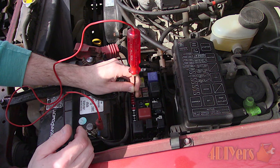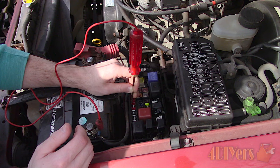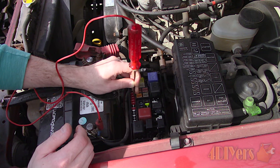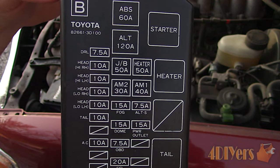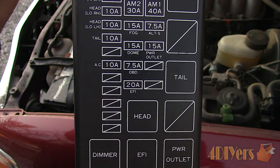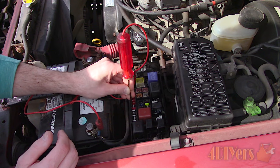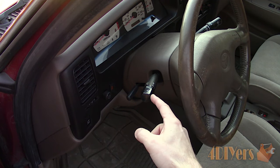On a good fuse, the test light will work on both sides. If the test light only works on one side of that fuse, that means the fuse is burnt out and will need to be replaced. On one side of the distribution box there are circuits with no power present, meaning the circuit is off and needs to be activated. Referring to the diagram on the cover, it lists these circuits for the vehicle's lighting such as daytime running lights, low beam, high beam, etc. In order to power up these circuits, turn on the vehicle's exterior lights. With the vehicle's key back to testing, there is now power present at each of the fuses and we can see the fuses are good. As to the high beams, these two need to be activated as well.